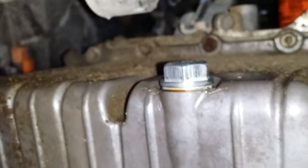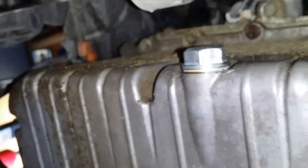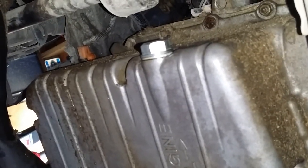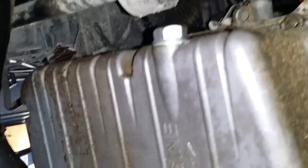There's still a small leak — it keeps leaking just a little tiny bit, but nothing compared to what it was. It was leaking all the way down the body, but they never ran it hot and never starved it for oil, because the head was extremely clean — no burnt yellow, orange, or brown residue. They always maintained it, which is the best case scenario.